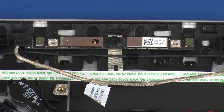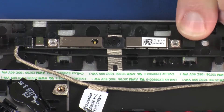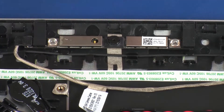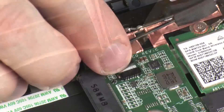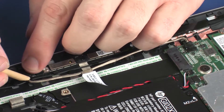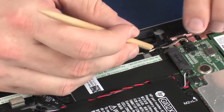Place the two rubber microphone covers into position over the microphones on the webcam microphone board and apply pressure to adhere them into position. Connect the webcam microphone cable into its connector on the system board and replace the retention tape. Route the webcam microphone cable through the routing channel and retention tape that secures it to the display enclosure.